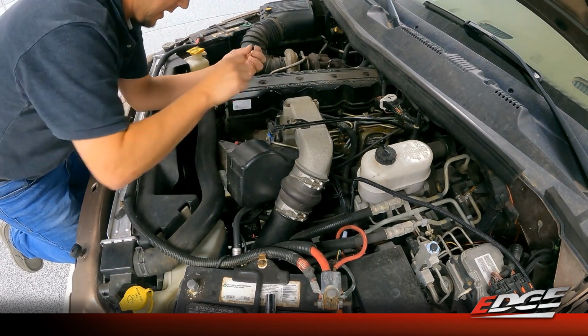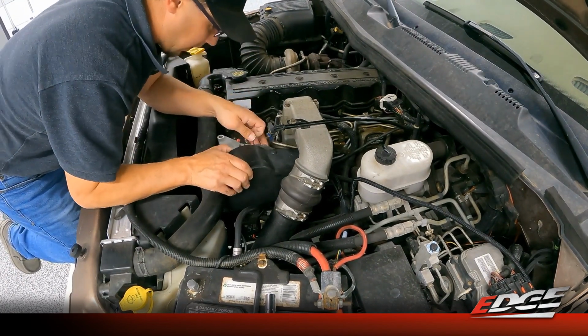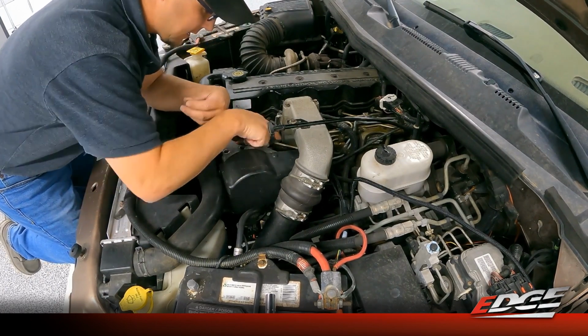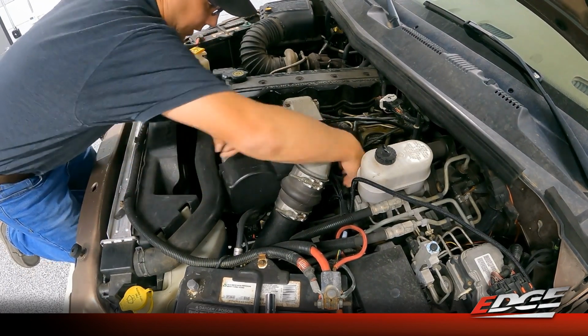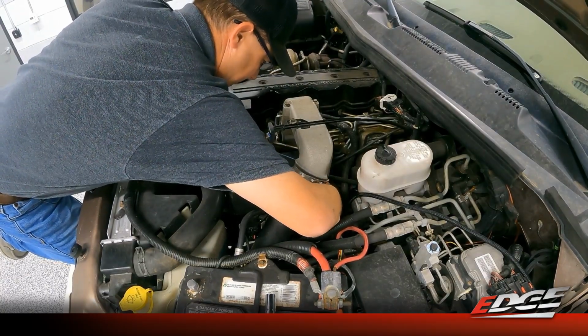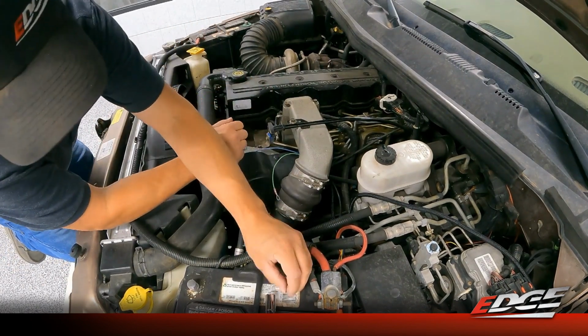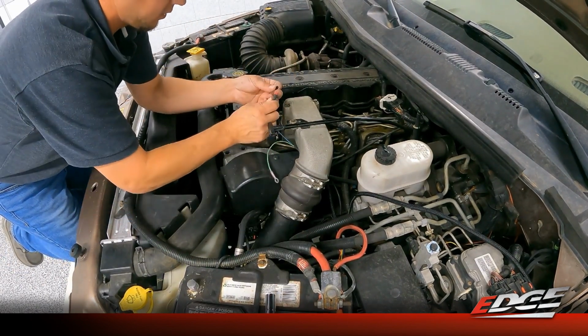But back to this tap here. The instruction manual will show you exactly which wire you need to tap, but it's here on the back of the VP44. You'll see 2 wire bundles on this device, and we need to access the top wire bundle and tap into the one wire here. Obviously, the harness includes the tap on it.